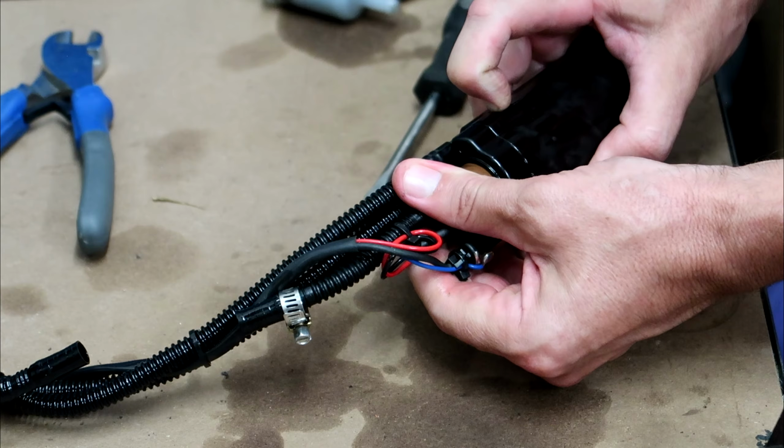Okay, so firstly we'll take off the seat and the breather hose for your fuel tank, and you want to grab your plugs for the quick disconnect on your fuel line. Unplug that, and it's always a good idea to put the plugs in so you don't get any crap inside the fuel line. Then you want to remove the electrical connection for the fuel pump from the top there. Just tuck it out the way somewhere.